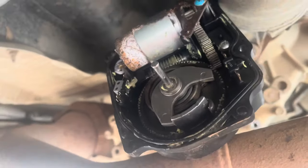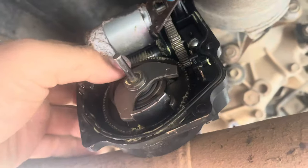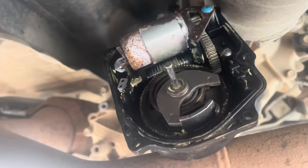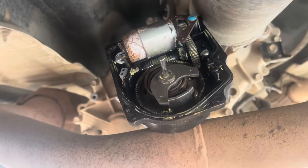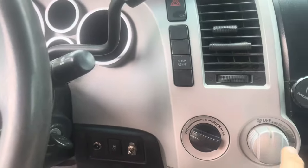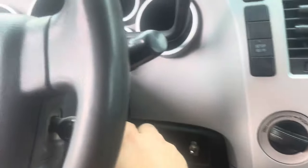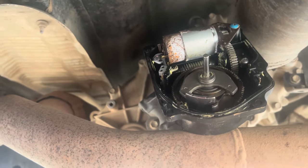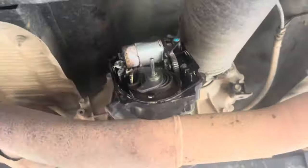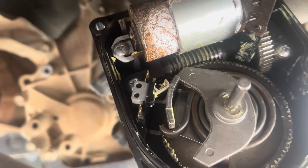You're just going to put this cog in. Your next big question is going to be, well, how do I time this thing? There's been a lot of stuff on group chats and comments trying to explain it, but this is the easiest part of it, I guarantee. Just watch. You will simply put your key in the ignition, leave the selector at two-wheel drive, and turn it to accessory. By doing that, it's actually going to reset this to the two-wheel drive position. There you go — it's in that position.